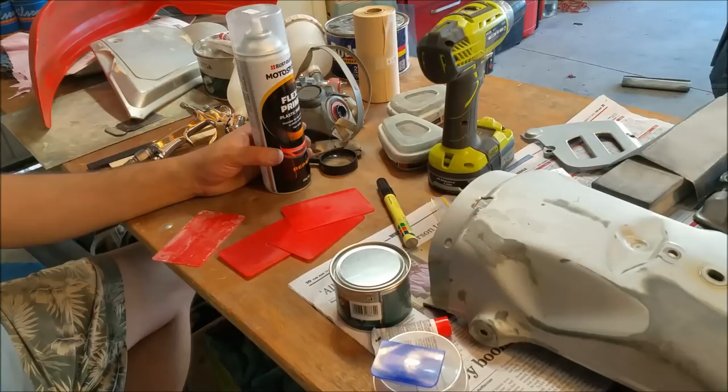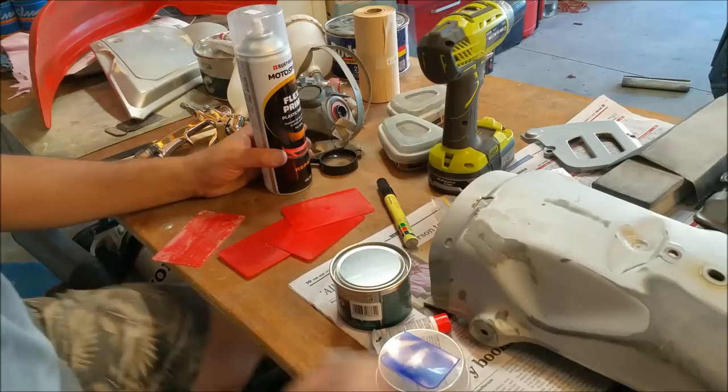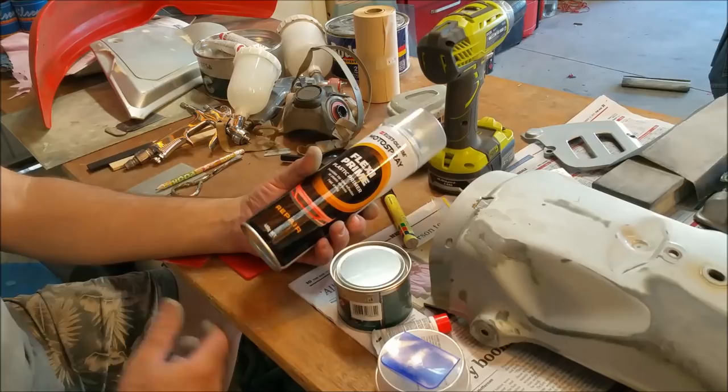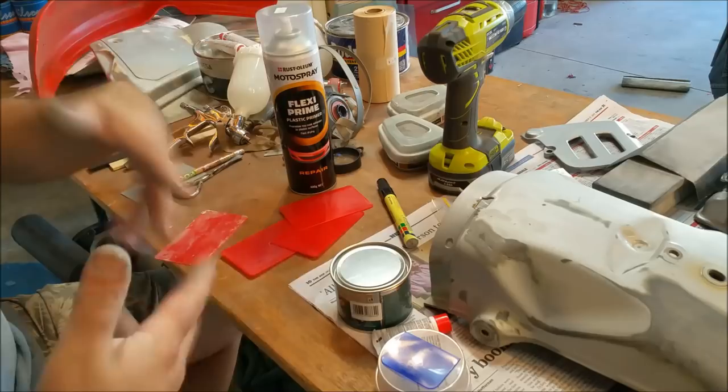Now, your first coat of clear, of course, I'm not using the 2K clear on this. I'm going to use acrylic clear on it because I have heard of going off problems with the flex aid that I've got on 2K paints. On 2K clears, that could be down to the fact that it's not mixed properly. If you don't mix enough of it, the paint can still crack. If you mix too much, you have adhesion issues, and also obviously drying time, that sort of stuff.